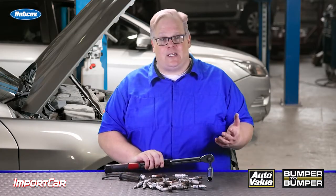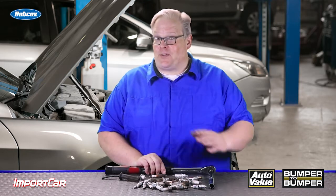Just to wrap things up: make sure you're using a torque wrench, you're not using anti-seize on modern plugs, and remember the ridges are there for a purpose. I'm Andrew Markell — thank you very much.